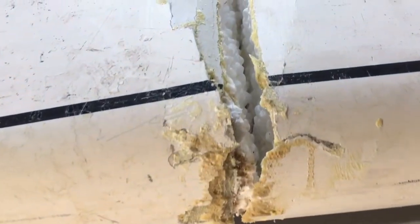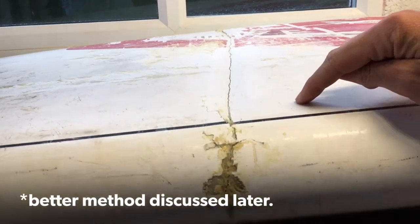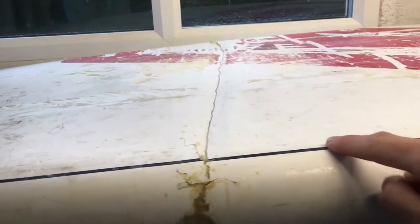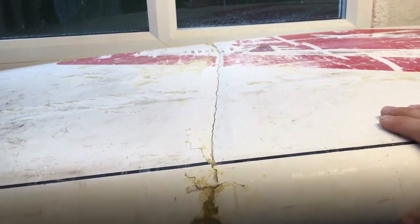So that's going to take a bit of time, and I've also got to sort this other issue out as well. The first job is probably going to be to cut away all this fiber here to give a good overlap surface, then put in a feather edge so I can smooth in the new resin.